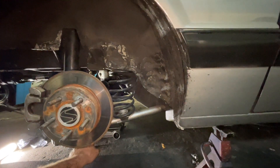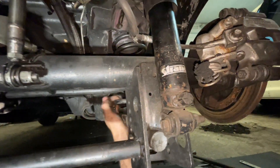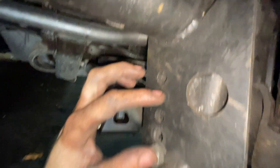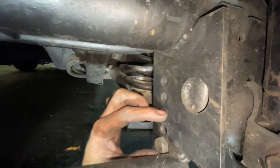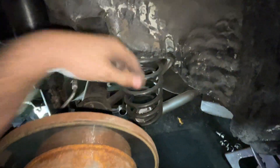I'm going to move the control arm back up one notch and put some weight in the back of it. Right now I can't put weight in the back or it'll kill the tires up in the fender wells because of how low I got the car sitting. This car has stock length lower springs, and with the bracket moved down from the normal hole, I've lowered the car that much. I've been running a 1.16 sixty-foot a few times and a best of a 5.01 at 142 miles per hour.